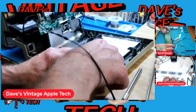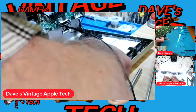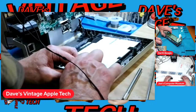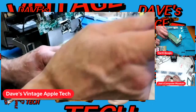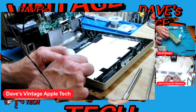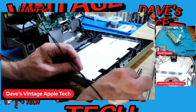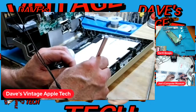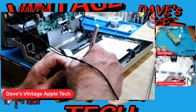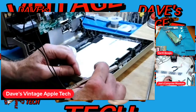Looks amazing. Okay, this power supply is actually dead, but it looks amazing, which is super awesome because it means that one of the stupid secondary caps has just gone wrong. Now, do they do the thing on that too, where they glue everything down in there? Not with these. This is doing the telltale tick, tick, tick, tick. So it's just shorted, the little caps. It's a capacitor war. That's broken. Yay. That's spare parts.